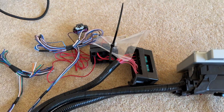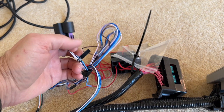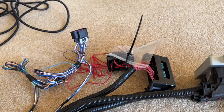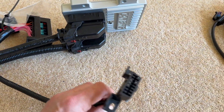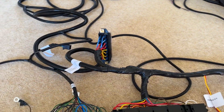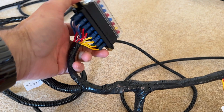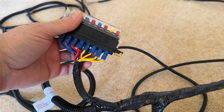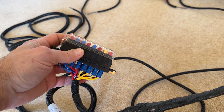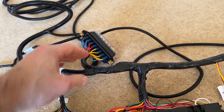We've got all this to mount and hide somewhere, while keeping it accessible — although you hope it never goes wrong. Should you ever want to plug in a unit to read error codes, it has to be accessible. I did something quite nice before and cut through into the engine bay and mounted the fuse box so it poked out there — really nice — so you could check fuses just by lifting the bonnet without fumbling about underneath the dash.